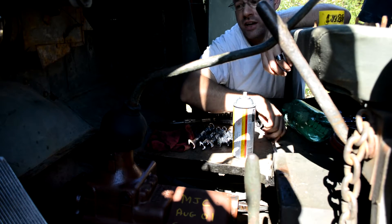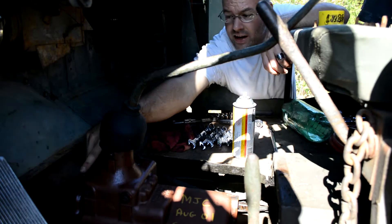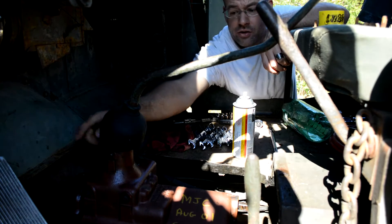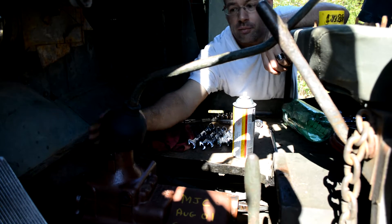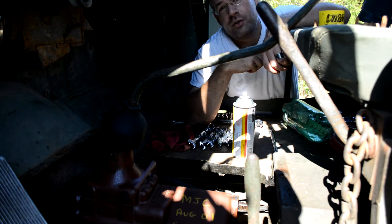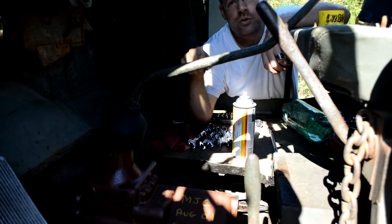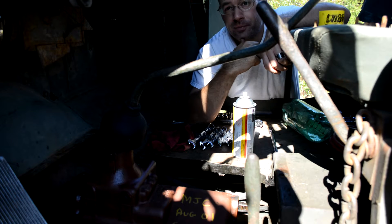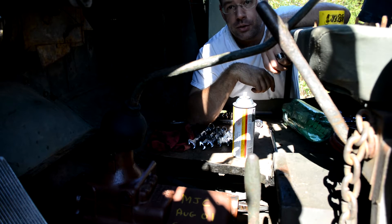One of the things I did want to check here is the actual breather. You can see it's moving freely, which means it's more than likely not clogged up. I should probably take that apart — I might do that later. But for right now we're just going to be changing oil because I don't see any kind of overpressure situation just yet. So let's get down underneath the Deuce and start draining fluid.